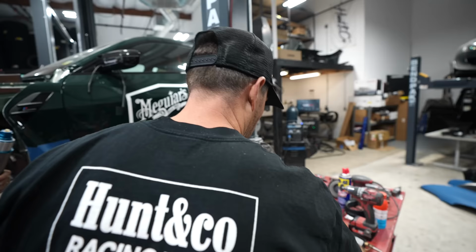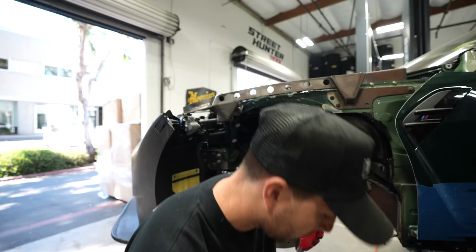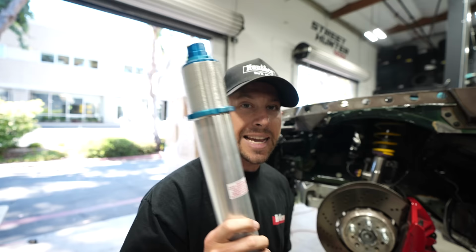They'll be sick. One reason as to why we also chose these AP Racing ones, I don't know if you guys went over this, is the length on this was one of the farthest that we could find. The ride height is gonna be high, and it's also gonna have a lot of droop. So we're not expecting this to get the car, like, because this looks huge. The car isn't gonna be sitting this high, I don't feel like. Our tire's probably gonna be only hanging off a couple inches, because the idea really in theory is just to get the tires off the ground so you can do a tire change. This isn't gonna literally elevate the car 18 inches in the sky, although I wish that were the case.